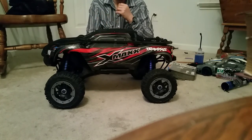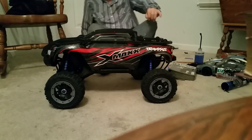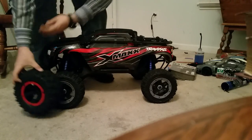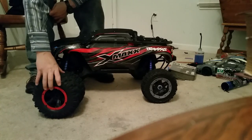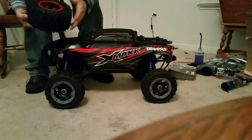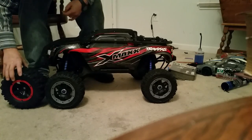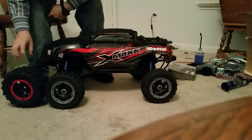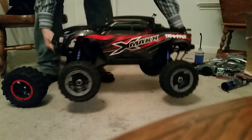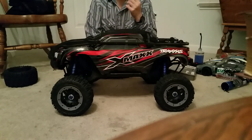Like the new tires. For those who know my setup, I can't exactly run full throttle with the stock tires. I'll show you the stock tires and even show you the size — they're the same size. The treads on this are a little deeper. Overall these are 7.65 inches, and these are 8 inches. Honestly putting them side by side there's not a very large difference. The biggest thing is the diameter, and the width is about three-quarters of an inch thinner. It's the King Motor Pioneers — the tread is pretty much the same as ProLine. You're gonna need wheel adapters if you get this.